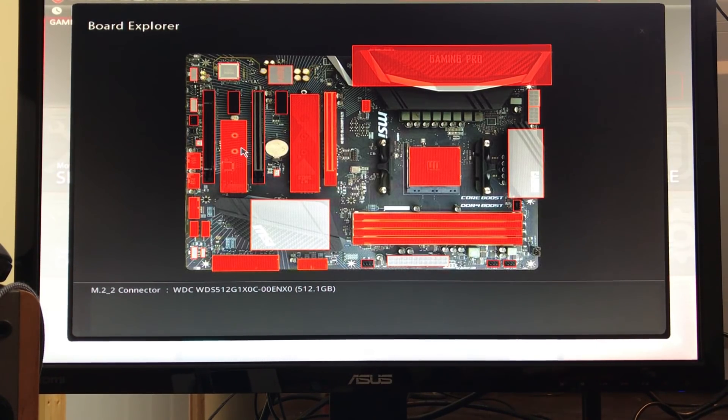So you've got the size of the M.2 to be concerned with — does your motherboard support the correct size? The X470 supports 2242 (22mm wide by 42mm long), 2260, or 2280. This was a 2280 drive. It supports PCIe 2.0 or 3.0 x4 lanes depending on which slot you use. Then there's the keying: if it says M.2 you've got the M key; if it says B key or B and M key, there are variations. Those are the things you have to consider before you buy one of these drives — even though it's nice not to use cables, it can get a little confusing on standardization.